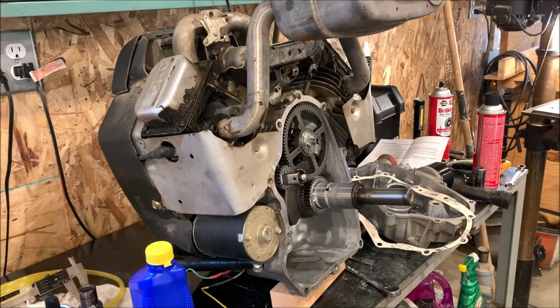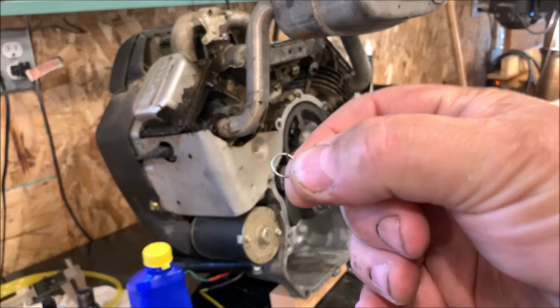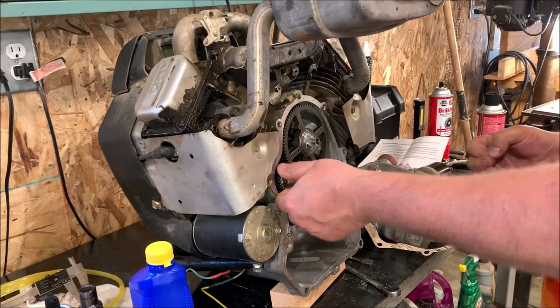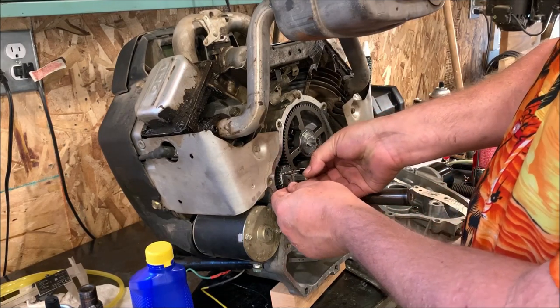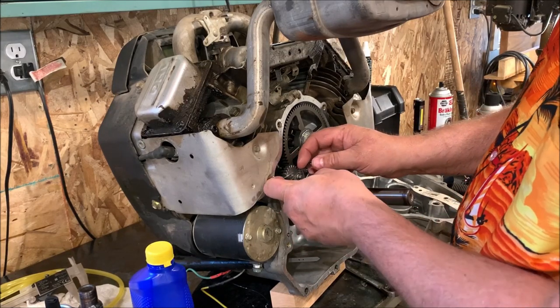There's a little circlip. I'm laying on my bench over here. I was just thinking to myself, did I get everything inside that needs to be inside? I don't know if you remember that earlier in the video, this little clip here. It's actually what traps this gear back into place. So that tells me that this has to, let's try it. We're gonna start it on the shaft, slide this out here,